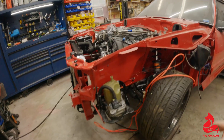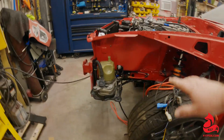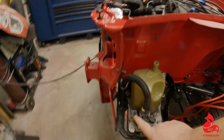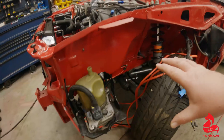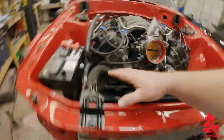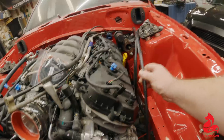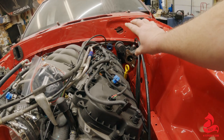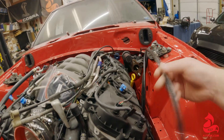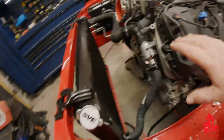So where I left off last time — working on wiring. That's the original harness coming through. I've got the Volvo pump mounted, the breaker down here, the wiring harness hooked up, and my GPS controller that will hook to here for the CAN bus signal, so I've got to get that ran. I've got the AC system installed, a power steering cooler, and one line left to make for the high pressure lines. I originally had the wrong master cylinder so I had to order another one, and I'll put that on and get the Maximum Motorsports brake line adapter kit in there.